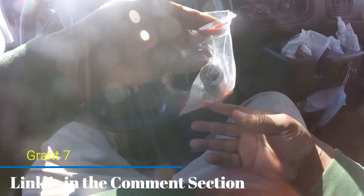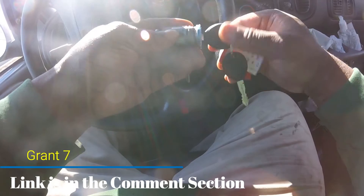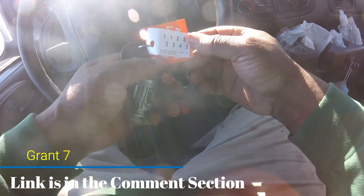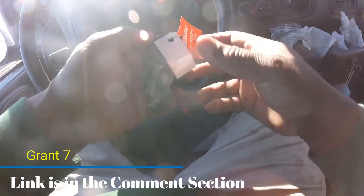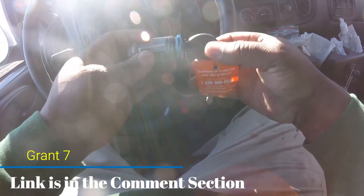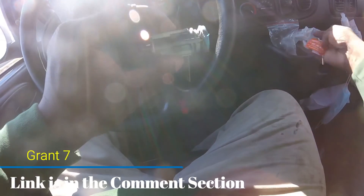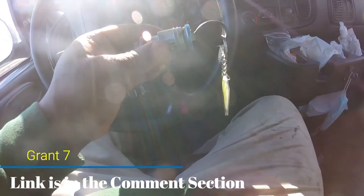Some of them will come with tumblers. Here's the ignition switch — here's the new switch — nice. So these are the place cards for the tumblers. There are no tumblers in this bag, but some of them will have an option for tumblers. Basically what that means is that instead of using the keys that came with it, I can change the tumblers inside this lock cylinder and use the original key.